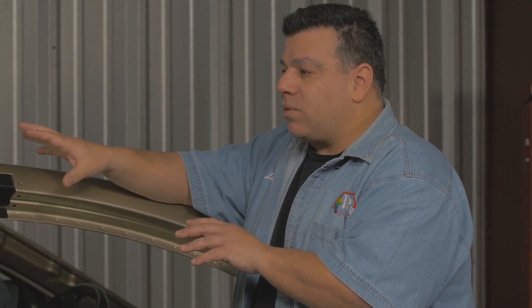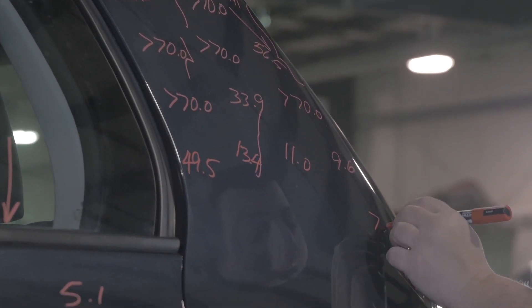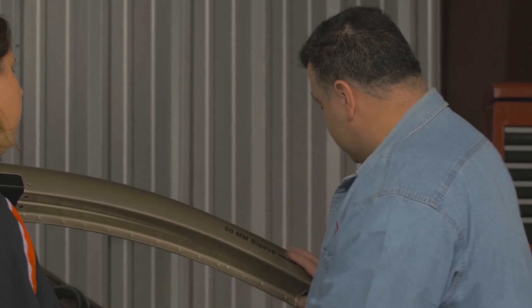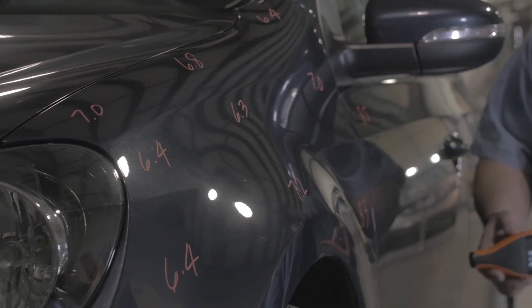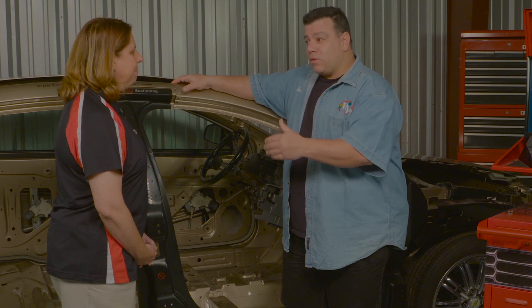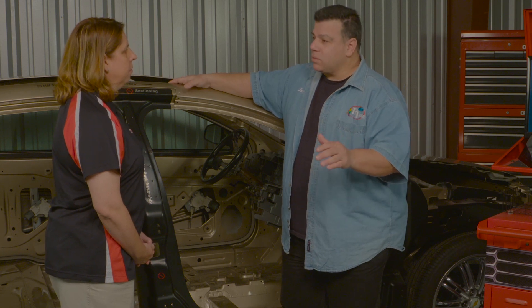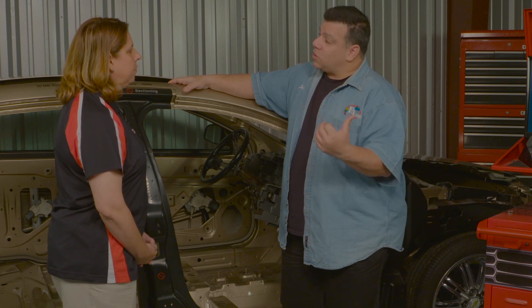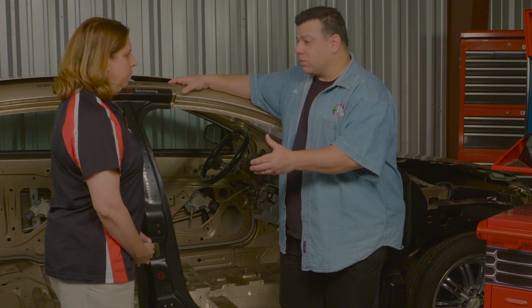You have to go 'up and over' — or in this case, up and across. This shop just went up and across and made a hard line. Some of the paint was already delaminating after only two or three months. There were rough edges in the back area where they left an open blend, and rough areas down by the hinge where they abruptly stopped painting. The front door probably should have come off and the whole side cleared. They had to paint the roof and the other quarter for paint warranty. We don't design the cars or insure them — we just fix them and follow what the manufacturer says.